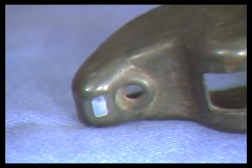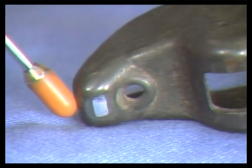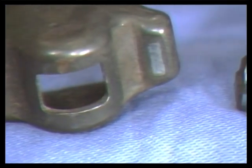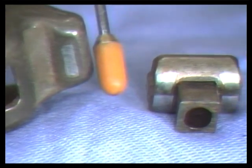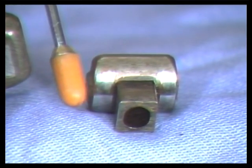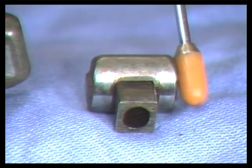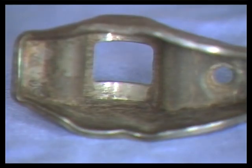Check the rocker arms closely for wear. Inspect at the point of contact the push rod ends and valve stem tips. Also make sure none of the push rods are bent. These aluminum rocker pivots are very high wear points and normally require replacement. If worn and not replaced, valve train clatter can result upon engine reassembly and operation.